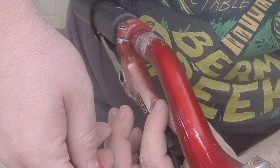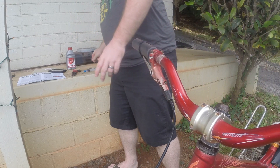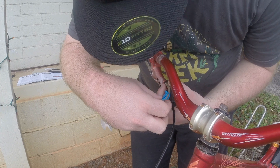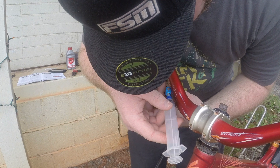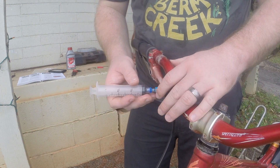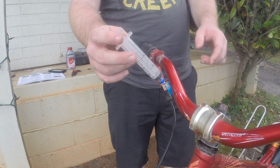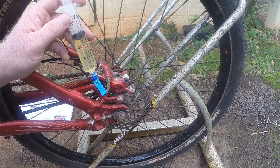It's a little dry in there. Remove that bleeder screw and get your empty syringe. Thread it on here. So that one's good there — open the clamp on that syringe. Pretty much what you're going to be doing is actually forcing fluid from the rear caliper all the way up to your front lever, so you want that one open to be able to accept fluid.